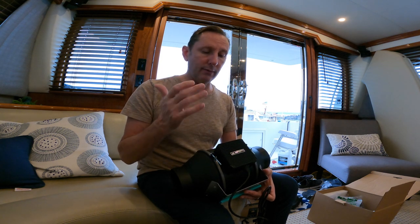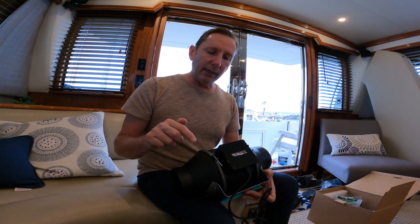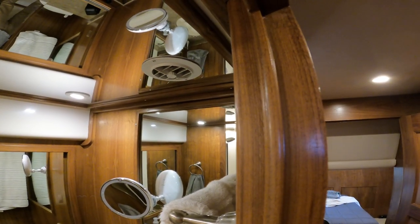This one is called AC Infinity — you can get it on Amazon. It has really high satisfaction ratings, hovering around four-and-a-half to five stars. It's very quiet at 28 decibels and draws very little power at 21 watts. With systems like this running almost continuously on your boat — especially in winter to control condensation — having the lowest wattage possible is absolutely key. The Jabsco ones we're replacing were over 80 decibels — extremely loud.